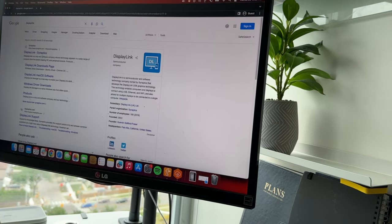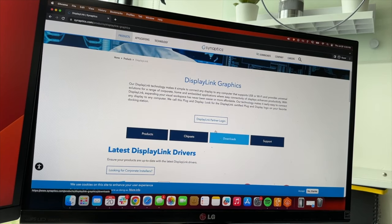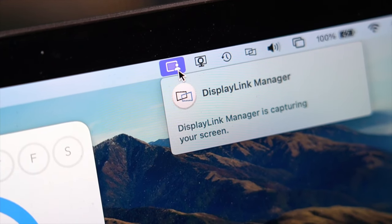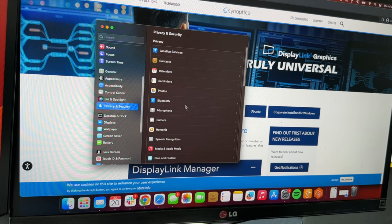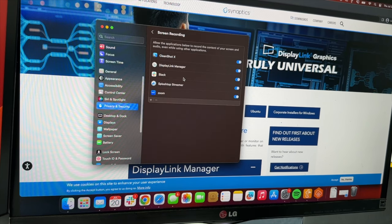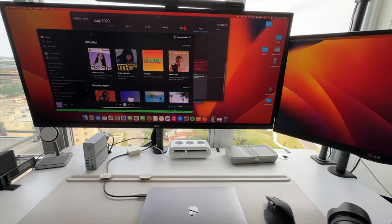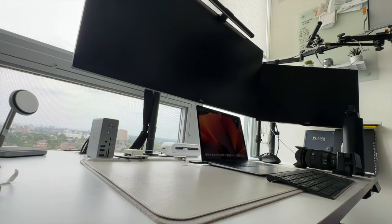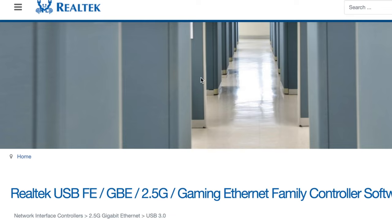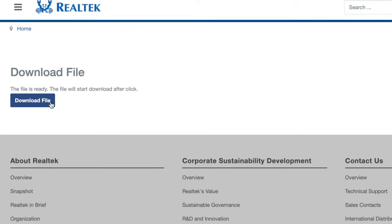In order for this system to work, you will need to install the DisplayLink drivers from the DisplayLink company website. Synaptics, the company behind DisplayLink, are very reputable and provide this standard for companies and individuals. You'll need to enable screen recording for the driver as it uses the API to digitally replicate your monitors on the extended displays — none of this information leaves your local computer. Everything is smooth and seamless when switching between displays and I have no issues with lag or latency. If you use Ethernet rather than Wi-Fi, be sure to install the latest drivers from the Realtek site as the Ethernet does require this before functioning properly. If you use Wi-Fi, you don't have to install that driver.